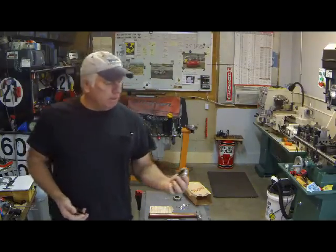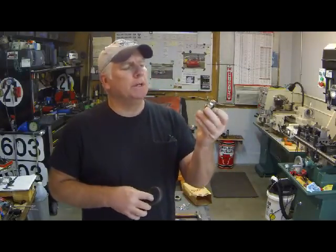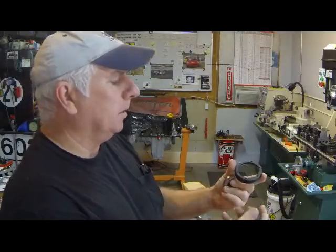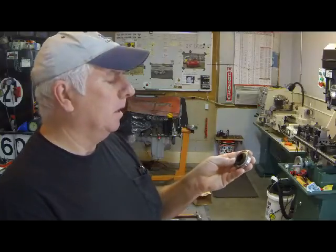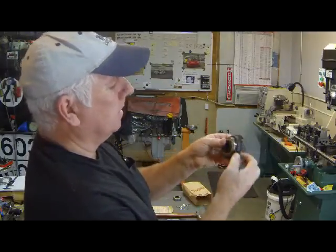The bearing that the 944 drive shaft revolves in is a small, sealed roller bearing, and it's placed inside this stamped steel carrier. To replace the bearings, we had to split this carrier apart and remove the old bearing, and now we're ready to replace it with the new bearings. We have our Delrin sleeves that we've machined to a precise fit for the drive shaft, and now we're going to place that bearing back in this carrier.